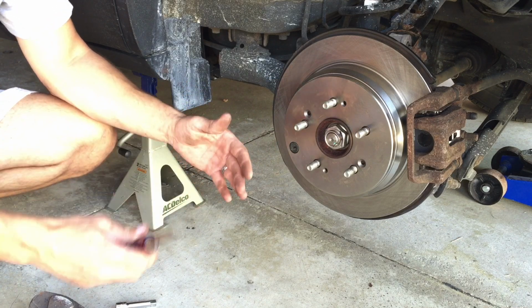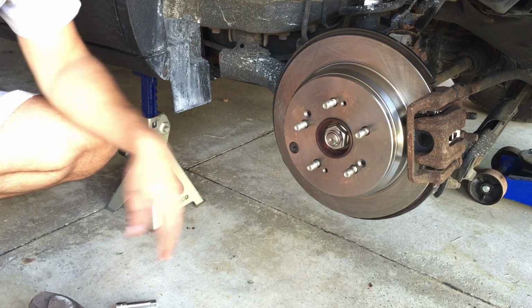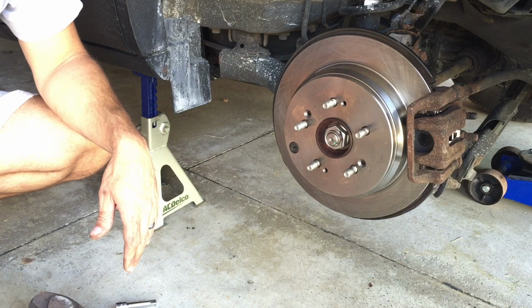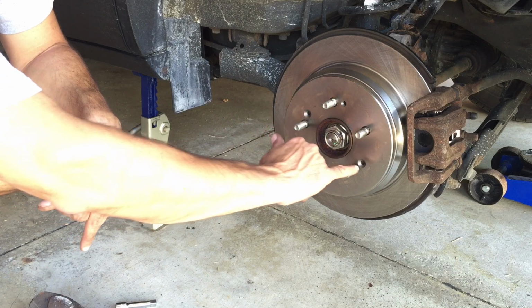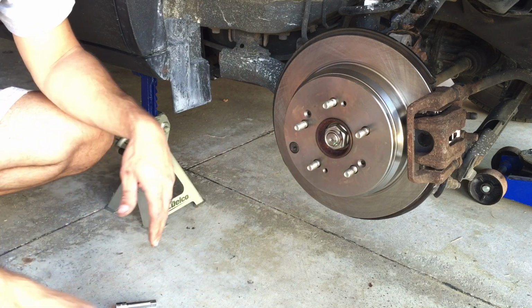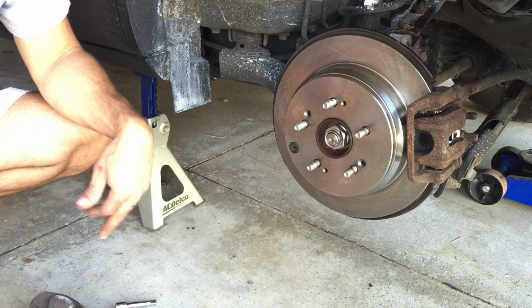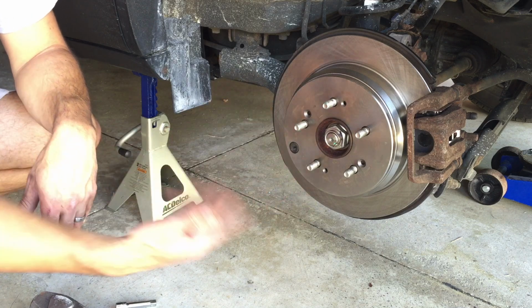And then if that doesn't work, which it didn't for me either, you could try to drill it out. So I grabbed a little drill bit. I think I had a 1/8 inch drill bit. That's what I ended up using, and I just drilled right into that, and then it pretty much came off. Actually, then the chisel did work because it kind of ground it up enough that I could pop it out. Now, you don't need to put those screws back in.